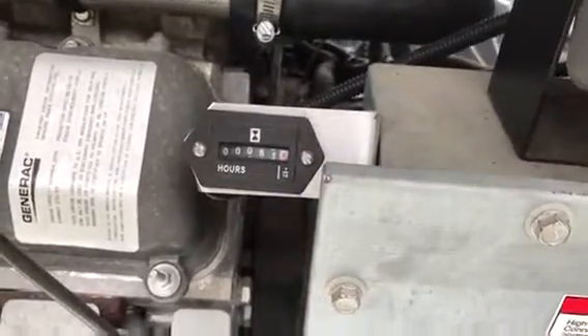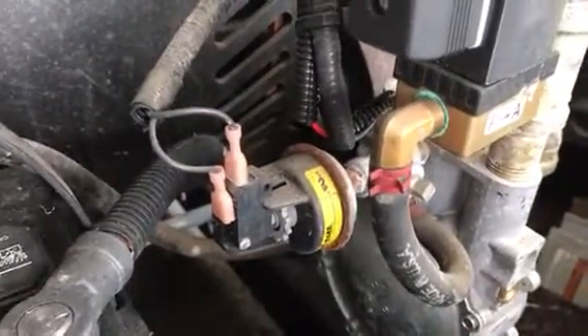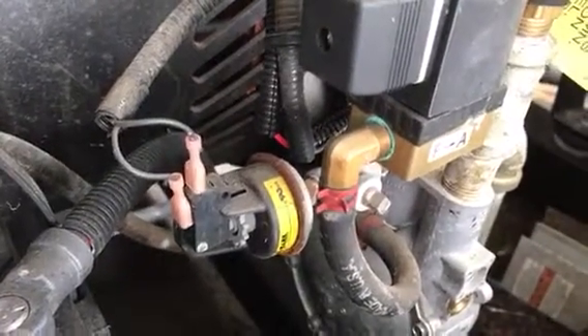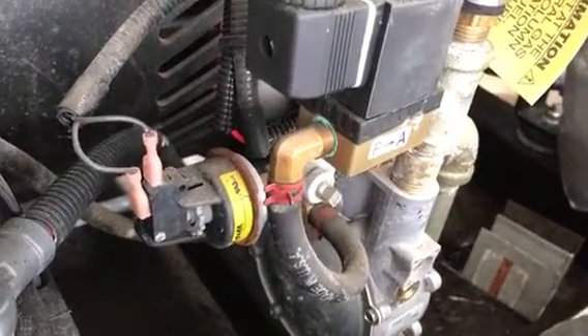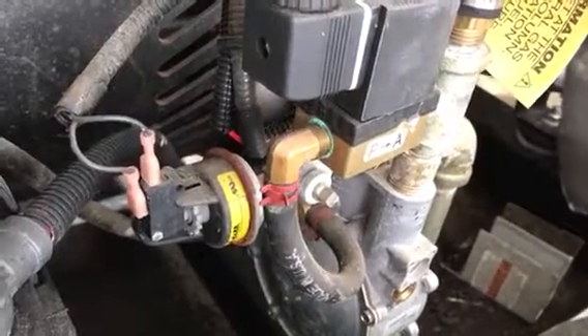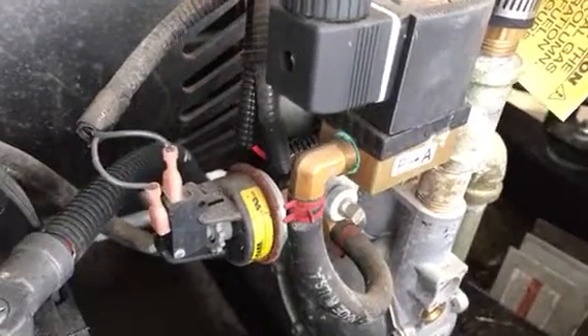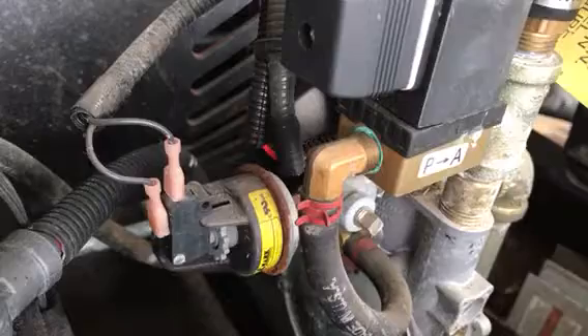That's pretty easy to do. Come around here to the fuel relay — the fuel relay is what turns on the fuel for the engine. It's got a 12 volt DC source on it, so all you've got to do is run a wire. The positive wire for the clock will come from this fuel relay. Now, since that wire is only insulated with one level of insulation, I like to have two levels of protection. I ran my wire in this wire loom here — you can see the plastic wire loom — to protect the 12 volt wire from any short.